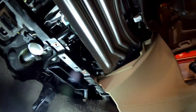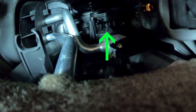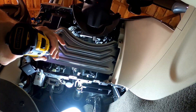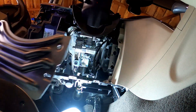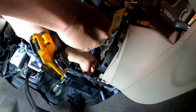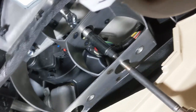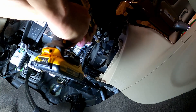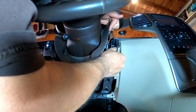Here we are getting our first look at what we're trying to get to. See right there where that gear is, in the upper right — you can see the motor housing in front of it and the gear in front of that. To help us get there, we've got to get this plate off. Four screws come out nice and easy. This next piece was a little more work, but not too bad — two bolts. Notice how I'm using my little nifty multi-angle socket thing here. And then that clip has one last little screw up here under the column. Make sure you get the right one; I actually pulled the wrong one out the first time.